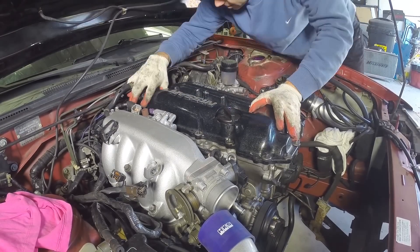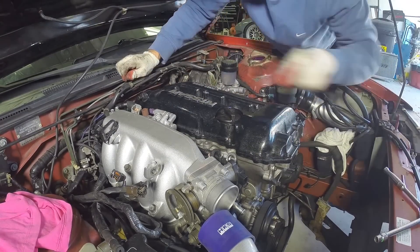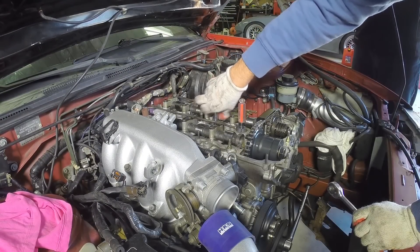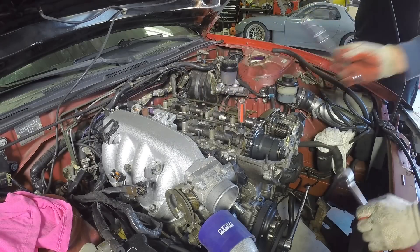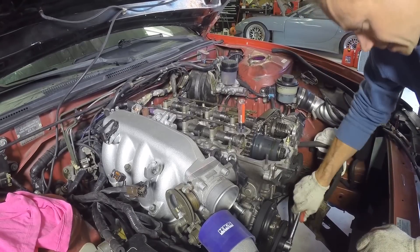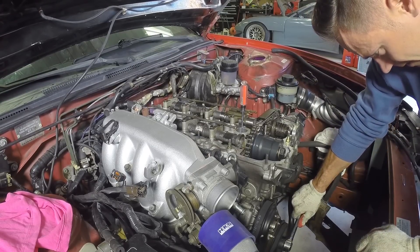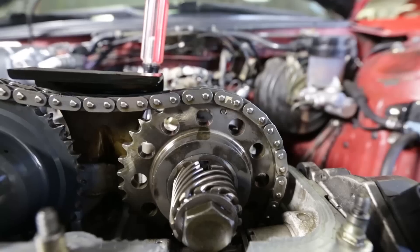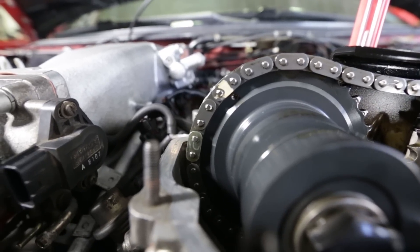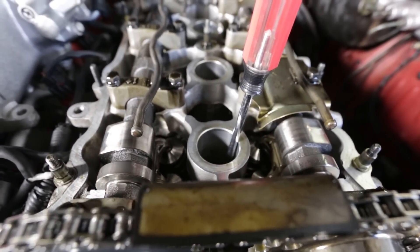Popping off the valve cover can be pretty painless, but some of the washers stick to the rubber grommets and tend to fall off when you remove it, so my advice is to remove all the washers before you lift up the valve cover. Spark plugs are the next to go, as you'll be able to spin the engine over much easier. The reason to spin the engine over is to set it to top dead center on the crankshaft, so that once you remove the head and cams, you'll have everything lined up to go back together with no chance of error. The sprocket marks need to line up with the silver links on the chain, or you can paint mark the links if you're not patient enough to spin the engine until the silver links line up. Either method works just fine as long as the crank is still at top dead center.